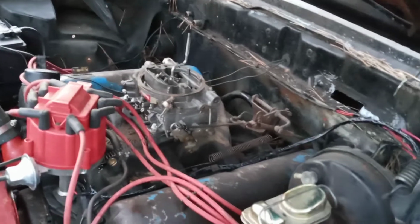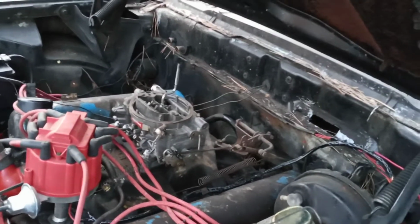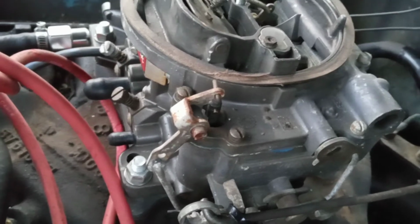And the reason for that is I had thrown a hose on there and thrown a bolt in it, and it's just not the right way to do it. And all them vacuum caps don't last nowadays. They don't. The front of the cap will rot off, and then you have a huge vacuum leak.